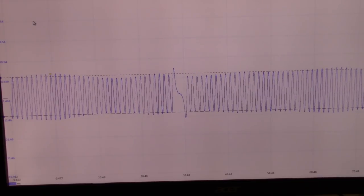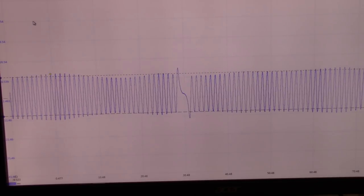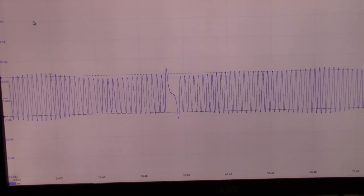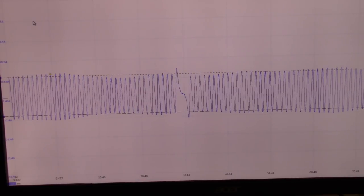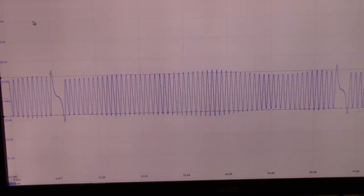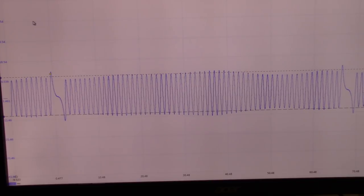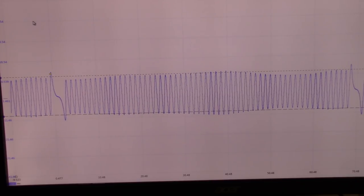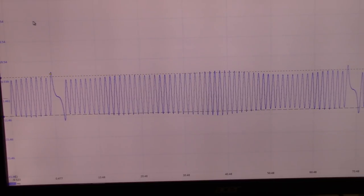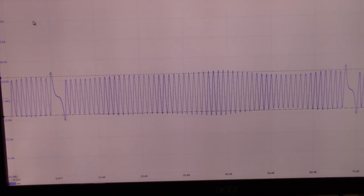I want to do something very simple in here, because I'm also suspecting there might be a little bit of that boot on the coil. Remember when we were spraying the coils and we had that little bit of a jump? I mean, it can be that it's not a full misfire. It's just leaking a little bit of voltage. Number 3 and number 4 are the ones. But like I said again, I don't feel a misfire. Even when you have a small misfire, it will drop. But I mean, it can be. I'm just trying to put my head together, see what I can come up with.